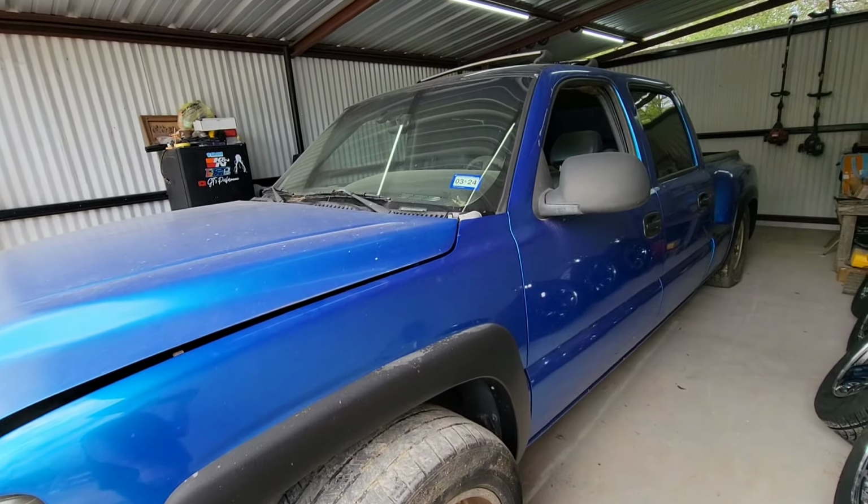As far as the bolt patterns, there are different websites that say different things. Some say Chevys up to 2007, and 2007 and up changes the 8 lug bolt pattern, and some other pages say up to 2010. The HD versions changed the bolt pattern. After 2010, it's a different one, the new bolt pattern. So that's why it makes it a little bit difficult finding some wheels, because there are not a lot of good looking ones.